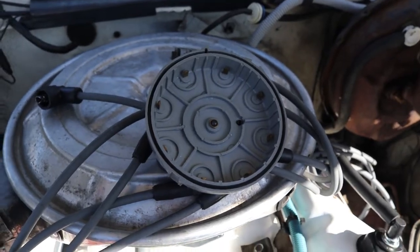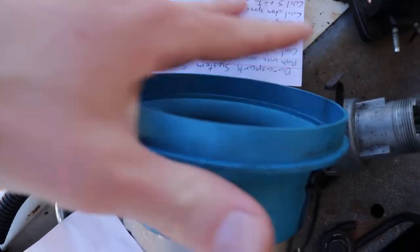Next is weak spark. Number one for weak spark is the coil — if a coil is out of spec, if it's old, if it's sat in a weird direction. They can go bad. One thing with an oil-filled canister coil: never leave the key on when you're working on the vehicle. The coil can get hot and explode. If you've ever touched a coil they can get raging hot. Always check that — you don't want hot oil blowing up in your face.